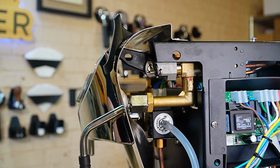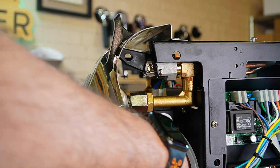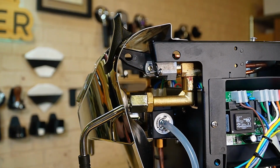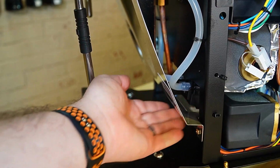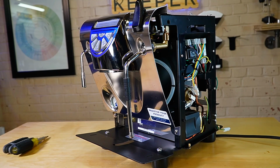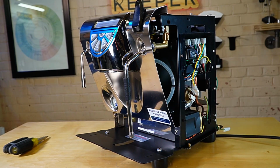You do have some collector lines that dump into your drip tray, so you'll want to make sure if you have any odd leak that all your collector pipes are connected and that they are lined up in that drip tray so that you're not getting a mess. Here, let's pan down. So this is a collector right here, and that'll dump into your drip tray. On the front of your machine, there's really not a whole lot to do maintenance-wise that you can't gain access to on the day-to-day. But as I mentioned just a second ago, this is the collector for your overpressure valve and your three-way valve. So make sure that if for whatever reason you're getting a little bit of a drip that's not going in your drip tray, that this is lined up properly.